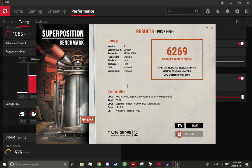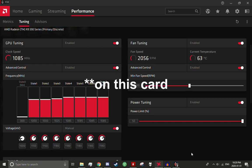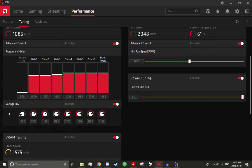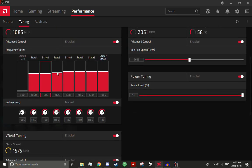And another clean run for the Sapphire R9 390X Tri-X 8 gigabyte card. If you'd like to copy my settings, I have them in text in the description and on screen right now. If you're wondering why I don't have all frequencies set to 1085 megahertz, it's because if you don't allow at least a little bit of fluctuation — down to about 1000 megahertz — the graphics card will become unstable and start to crash. These are my voltages, frequencies, and my power limit set to plus 50 for states one, two, and three.